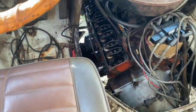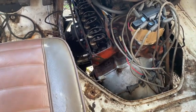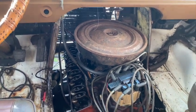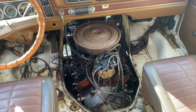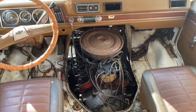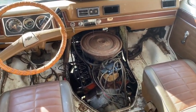I did have to get a new exhaust manifold on this side because the original one cracked — the other wasn't so bad, so I'll clean those up and put new gaskets on there. The front end of the motor is all taken off — the power steering pump, water pump, alternator, and AC pump — so we'll clean that up and get it all put back together. Hopefully this thing will run pretty good after I replace the oil pan gaskets and the transmission filter and gasket, good enough to drive it up to my property.